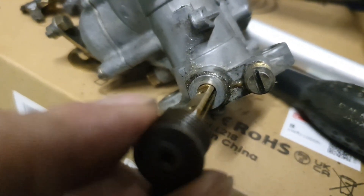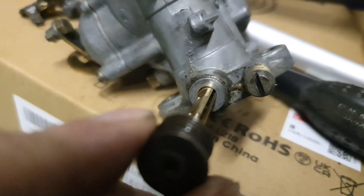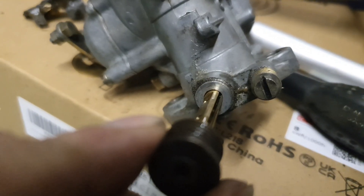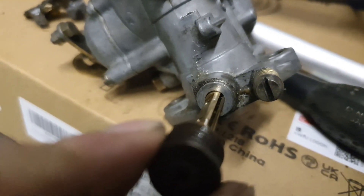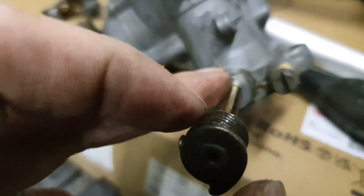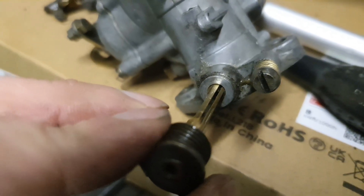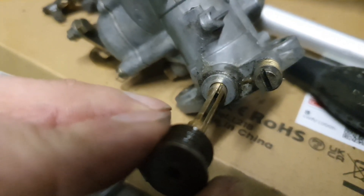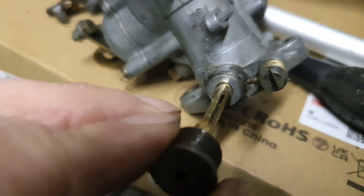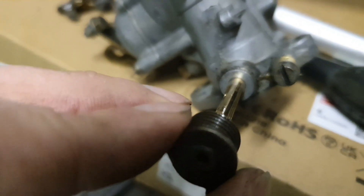What seems to be happening is that as you open the throttle, the way the throttle linkage is set up it pulls and twists, opening a massive vacuum leak right above the butterfly and completely throwing the air-fuel mixture. You can see the bore is absolutely wallowed out.